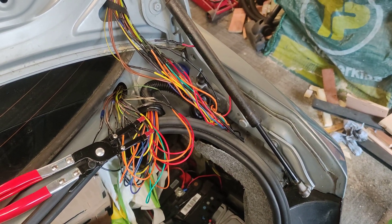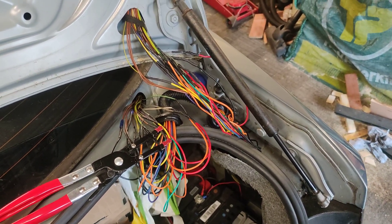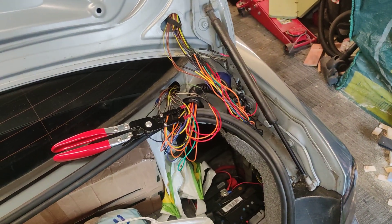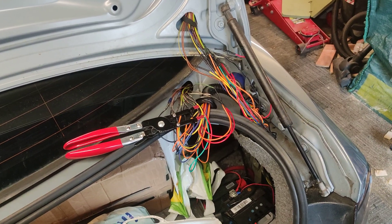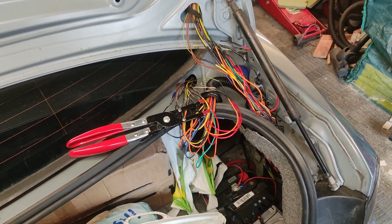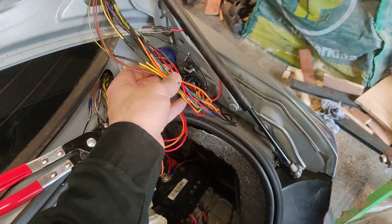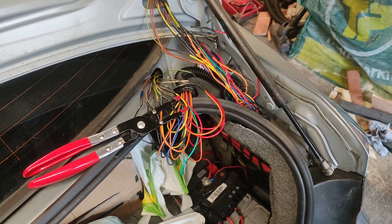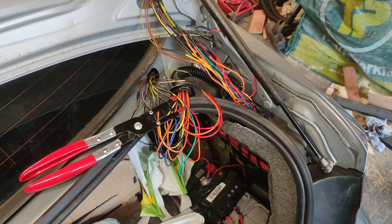You might need fewer wires depending on your car, though I can't see that being very different since you'll have the same stuff on the boot lid of any E90. If you've got an LCI model, maybe you have a few extra or fewer wires due to LEDs. Generally I'd go for 18. You don't even have to have them colour-coded — if you just have a roll of black and red wire, as long as you keep track of what you're doing and do one wire at a time, you'll be alright.